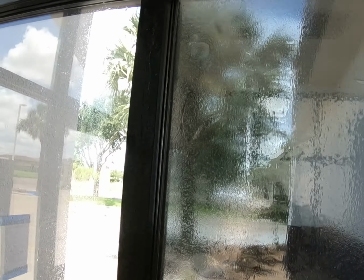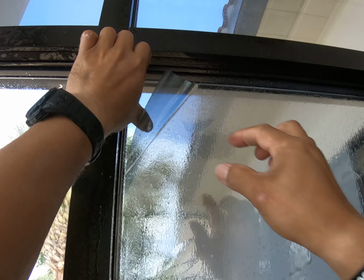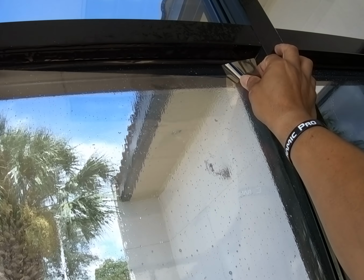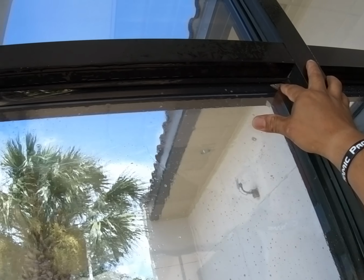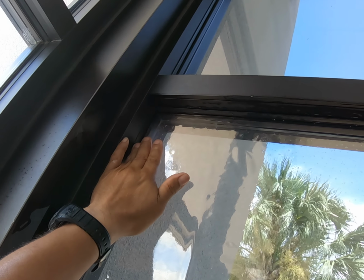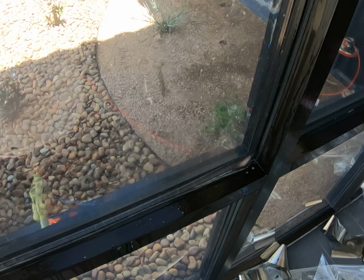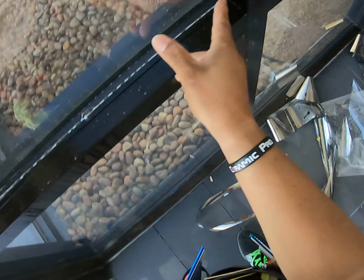Make sure your pattern is 100% covered as far as water. Make sure you lick your fingers that they're gonna contact. One, that one there. Corner to corner. Align it real quick. Corner. Corner. Don't even look anywhere else. Just look at those corners. If they're aligned perfectly, the film under you is gonna fall where it needs to be at. Then look at the bottom and start squishing it up, moving the film up. There you go. Exactly where it needs to be at, 100%.